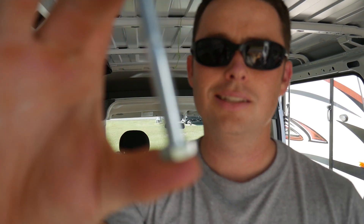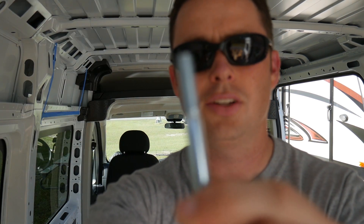Today to finish up the subfloor project we are going to put some bolts in. I was originally going to free-float the floor, but it's not a house — it's moving — and I'm worried about things flying in the event of a wreck. So I'm going to bolt them down sparingly, using a 5/16ths bolt, and after that I'm going to use a T-nut. In case you don't know what a T-nut is, it's basically a special kind of washer with teeth.